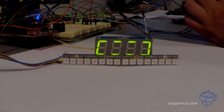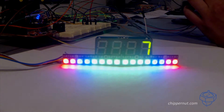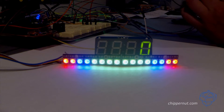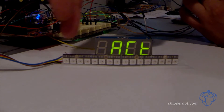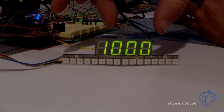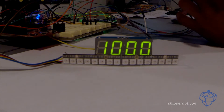Let's shift through the menu options and talk about each one. The first one is brightness — it's pretty self-explanatory. It allows you to adjust the global brightness on the shift light display. The second option is the activation RPM. This is the point at which the graph starts reading your RPM. One of the new features for version 2 is that this display now goes above 10,000 RPM. Because there are only four digits, it's just going to divide it by 10, so it kind of looks like it loops over itself.